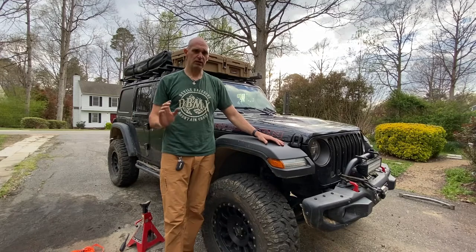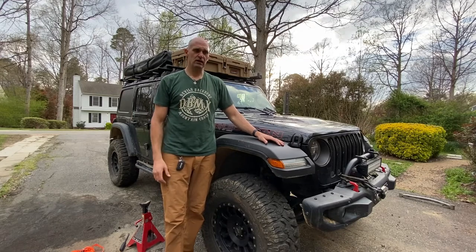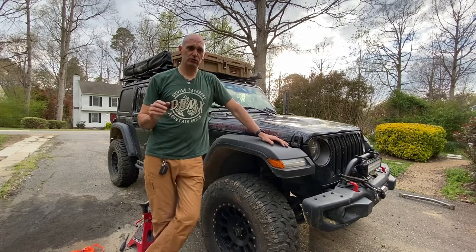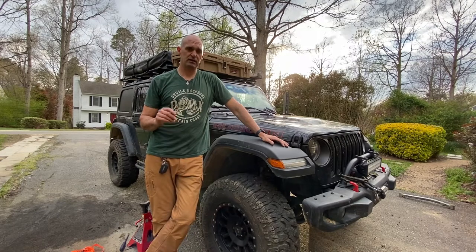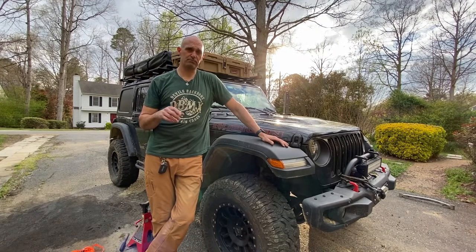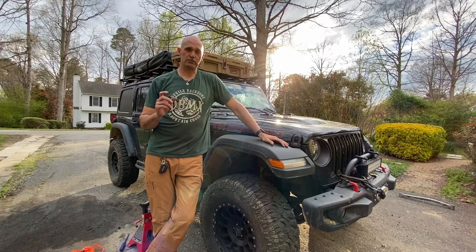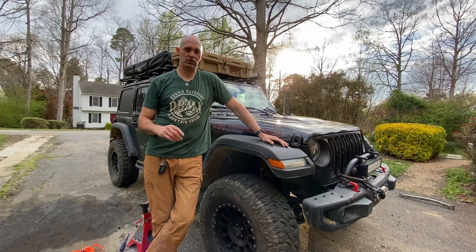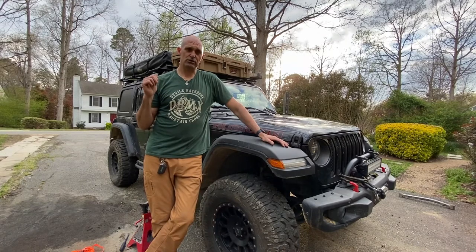So we got a similar setup coming for the rear axle. But with that one, I think we're going to be doing both the lower and the upper control arms to replace the stock ones. So we got some geometry correction brackets from Metal Cloak for that. So we're going to put a complete setup back there. Hopefully that stuff comes in soon so we can get the rear dialed in. Now, we didn't do the upper control arm on the front because the stock upper control arm is a pretty stout piece by itself. And with the geometry brackets, we don't really need to mess with that. We're not going to go into replacing them. So I think the install on the rear is going to be a little bit more involved, but I think it's going to yield some pretty good results.